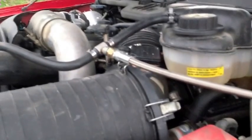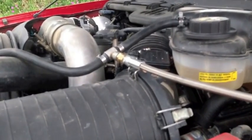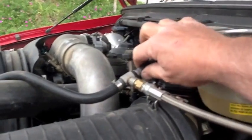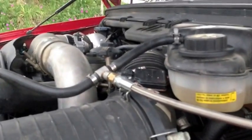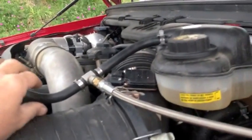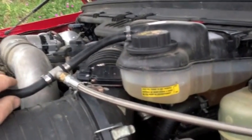When I'm checking for head gaskets or an EGR cooler, I've taken one of my fuel pressure testers and spliced a T into the hose. I transfer this hose from truck to truck so I don't mutilate the customer's hose. This way I can check the cap, the degas bottle, and check the entire system.